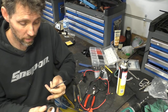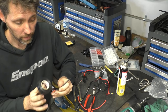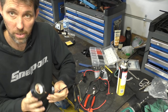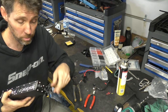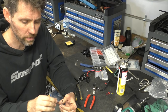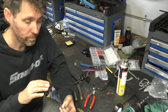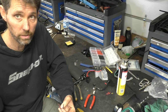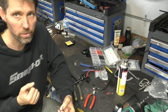The lights themselves have got a reasonably short tail on them, but it's long enough to get inside that tubing so there won't be any joins outside the tubing. Looking at this wiring, it's thinner than the wire I've got running from the back of the boat to the front, so I'm pretty confident that 12 gauge wire is going to be up to carrying the current these lights require. What I'm going to do now is solder a length of twin core wire straight to the light that I can feed through the tubing — the windscreen grab rail. Once it's through, that'll be the final solder I do in the boat when I connect it up to the relay.